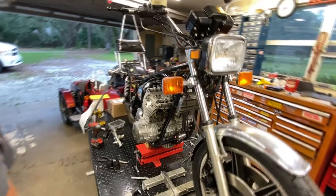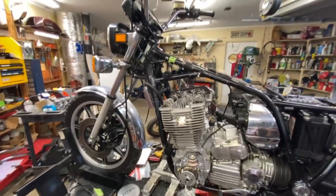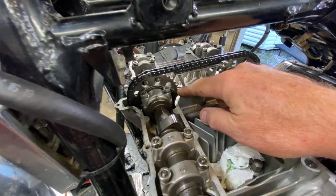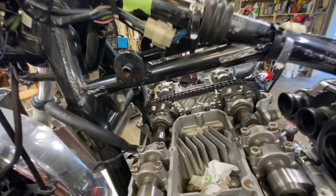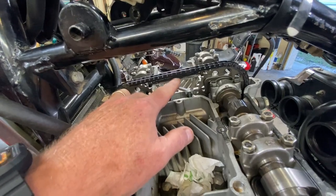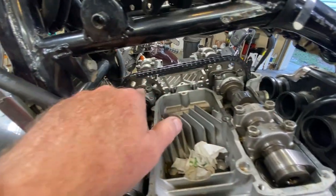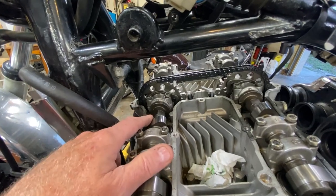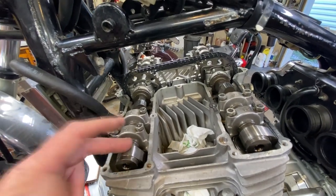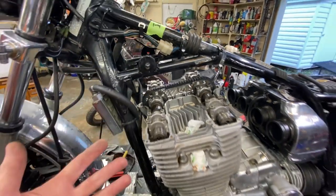On this one it's a little different because you have to disengage the sprocket bolts — the sprocket against the cam. I looked at a video online where the guy just took out the exhaust bolts, and that freed up enough slack to take the fixed tensioner out. Then once that cam's out, the other one comes out. So we'll leave the intake in but just take the exhaust bolts out. Be really careful not to drop them in the motor — stuff a little rag in there. We'll follow the service manual mostly, but with slight modifications that make sense and make it quicker and more efficient.